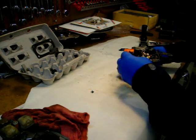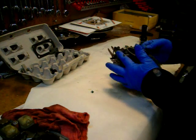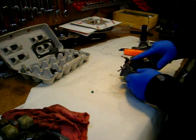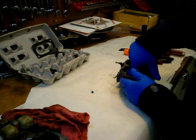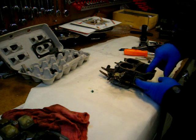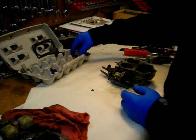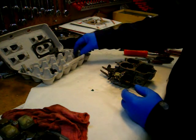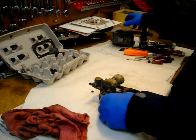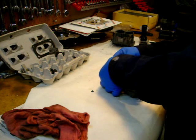Basically what I'm going to do is step out the back door with a can of carb cleaner, put my face mask on because the stuff likes to blow back at you. I'll spray through all the passages, probably come back with a little brush to scrub some of the garbage out. Then I'll clean up the body and give each of the other pieces a shot with the carb cleaner as well.